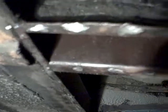Whoops, that's where we've cut it away because the floor panel will end right on the seam at the top of your camera there, the top of your screen. And so this channel, in fact, is in nice shape on this car. Oftentimes these channels are perforated or rusted along those flanges, but we've cut away. Here's actually one small perforation there, but Stuart has cut away the spot welds in order to be able to weld the new piece right along that edge on the side, on the inboard side.